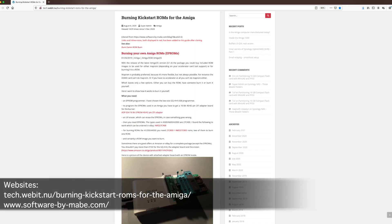While searching for information on programming ROMs, I came across an Amiga blog where someone was talking about making ROMs for their Amiga computer. It turned out that specific Amiga model used the very same type of ROM as the Macintosh Classic — same number of pins and everything. What they suggested was ordering one of these replacement rewritable ROMs. Unlike the original ROM which can't be overwritten, these have a little window that you can expose to UV light to erase the chip, then write new code to it.